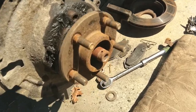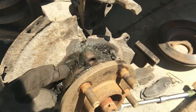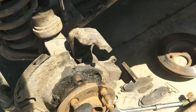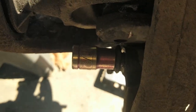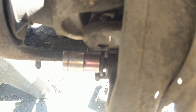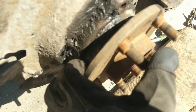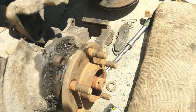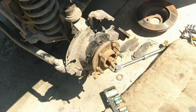If you've done this job before in the last four or five years, this thing should come off rather easy. The split point is right here on the boundary of the brake shield. What you want to do is try and hit on these nubs to help break it free. Loosen the bolts a little bit — not all the way — then put your socket on and hit that. Once all the bolts are out, this one should come out. If yours doesn't, prepare for a lot more beating, chisels, heat, and lots of cursing.